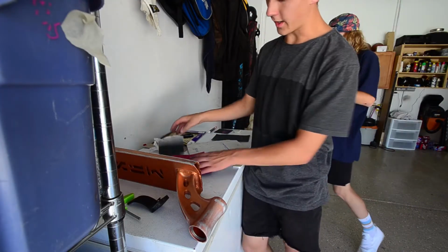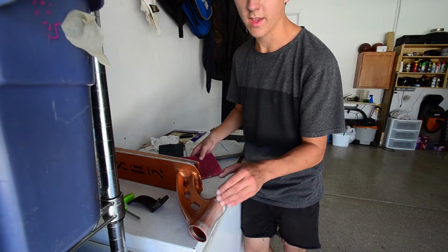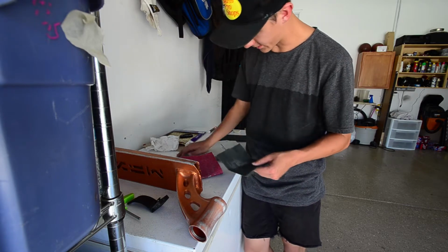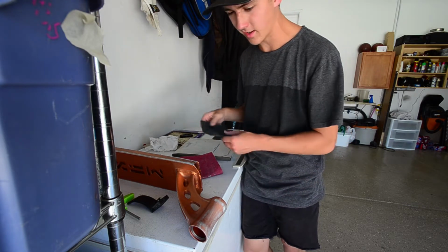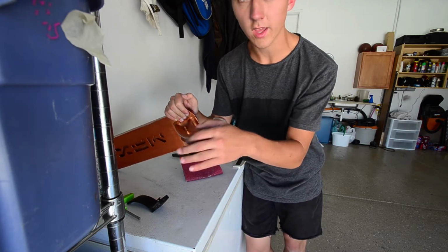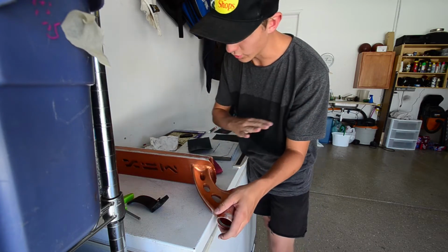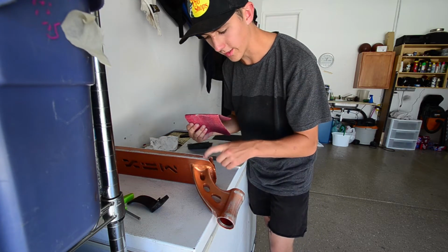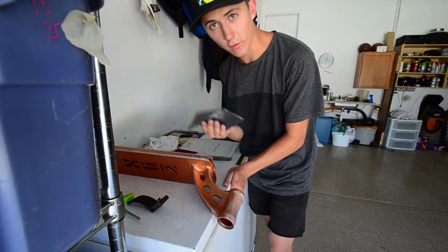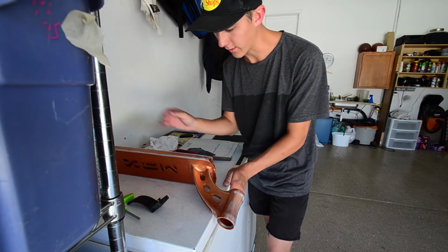After I go through this really, really coarse sand to get all the dimples and the bumps out, then I get 280 grit sandpaper. This is just a big old sheet that my dad had. Then I scratch it off to make it super, super smooth so that once it's painted, it looks really good once it's all done. I'm just gonna go through the whole deck. I do rough to get all the deep cut type things out, and then I go over this to get the paint off and to get the paint smooth so that once I paint over it, everything will be all perfect.